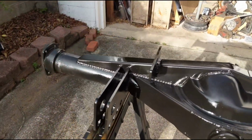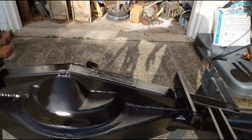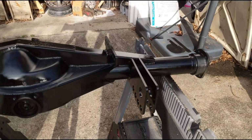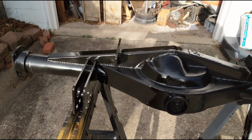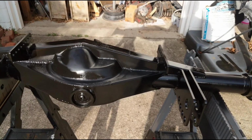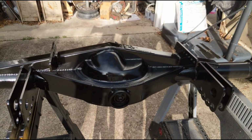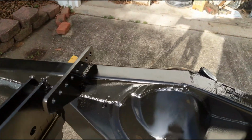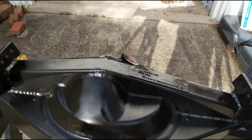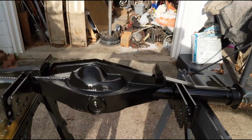So that came out a lot better. Still not going to be perfect because I didn't sand it all the way down, but we're not after perfect, we're after close enough. So we're going to let this coat dry and then spray one more coat on the backside. Then I'll have to flip it over and do the front. So I'm guessing that prep spray I had, I just didn't get enough time to evaporate off after I wiped it off, you know, and it just had some residue left on there, and that's what caused the fish eyes. And now since there was fish eyes, even though it's not fish eyeing, it still got the bumps. So it's kind of a faux hammered finish. So we'll go with that fancy stuff. Anyway, we'll let this dry.